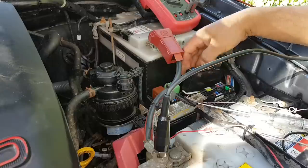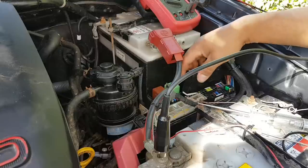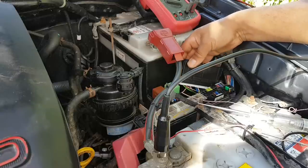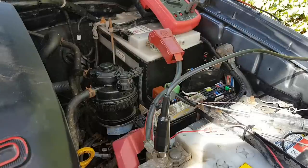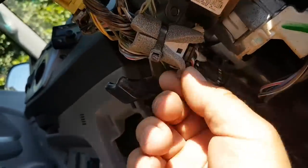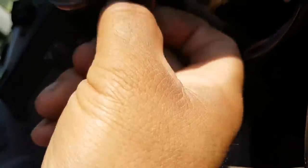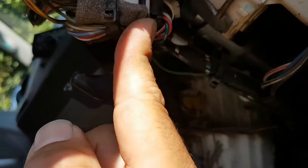So my problem is from the fuse box back to the inside of the car. We're going to dismantle the steering column area. I think the wire changes colour - it becomes a red or pink and white wire. We'll trace it under the steering column and check continuity. I removed the cover and everything comes to this connector here, which is for the clock spring. All the wires are black here, but there's a plug at the back that connects to the loom - and that plug has what I'm looking for: a white and red wire.